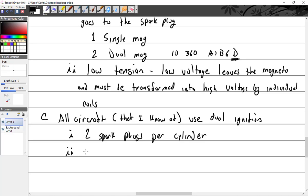You need eight spark plugs for a four-cylinder, twelve for a six-cylinder, twenty-four if you have a Baron with two six-cylinder engines. A radial engine needs at least ten — they make five-cylinder radials. The shop I used to work at had a mechanic gapping spark plugs too close. You can't un-gap a plug, so they had to buy new ones for every airplane for the next year — tens of thousands of dollars. Don't do that. Two spark plugs per cylinder gives you a more efficient fuel burn.